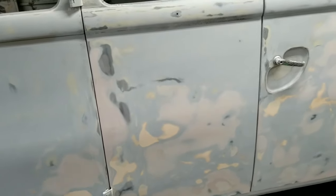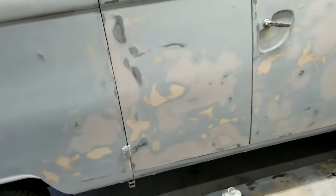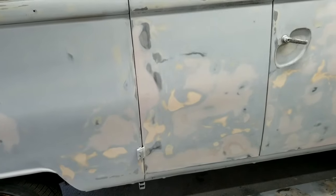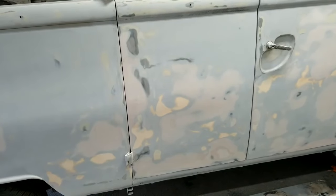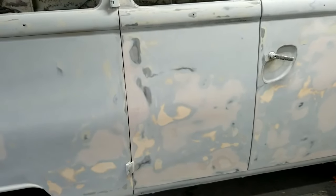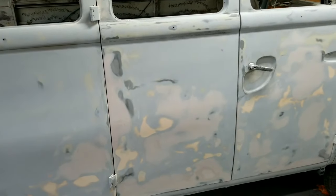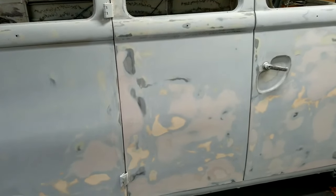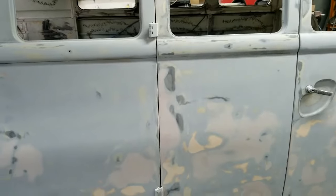One of the things I was going to say — if you guys really want to see what my nicer work is, nobody's watched this video. There's a 65 Mustang playlist on the channel. Go to the further-towards-the-end videos — there's only like 1,300 views on them. Take a look at that Mustang — that was all blocked with a DA. I mean, it's straight as an arrow. I blocked it with a DA, then did like one hand block with that little block I showed you. My buses I just DA'd them and did the corners and edges with the soft block — no hand blocking at all. But on that car I did a quick hand block after the DA, then painted it.